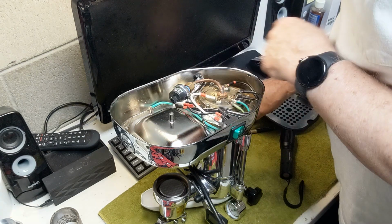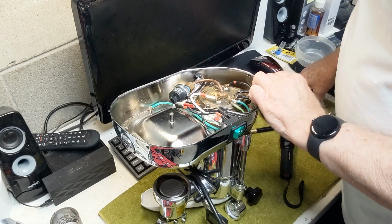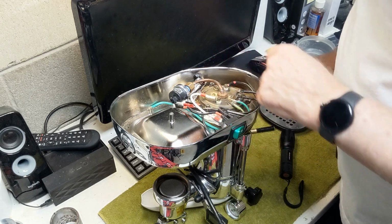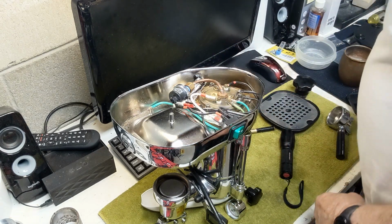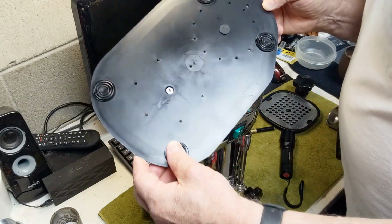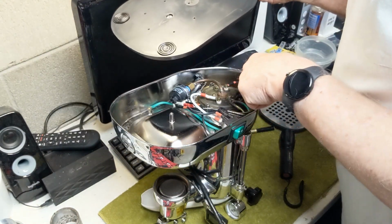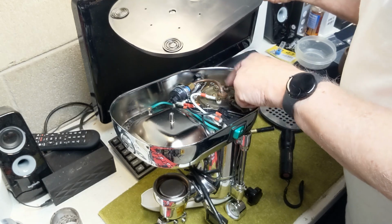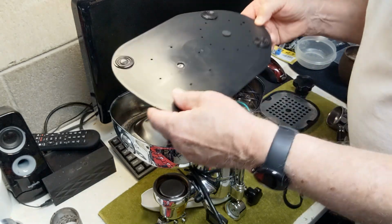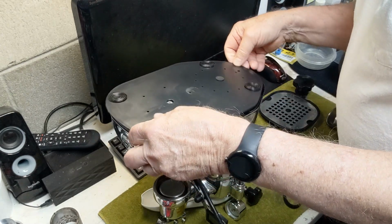So that's the adjustments on the pressure stat I wanted to do. Everything else on the machine is fine on the inside. And then just for giggles, let's try the cover. The cover has the 4 feet on it. I did put the plug in the middle because it will keep anybody from touching the pressure stat tube, and then the screw is in place here.